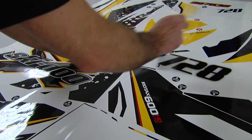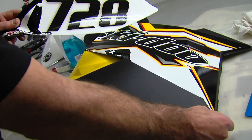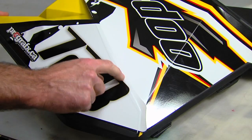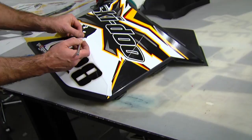The second piece we're going to use is the lower panel. This is the XRS kit, so you get your custom race number on there — you can pick whatever number you want. There's a point of reference: we want to line up this bottom edge — it goes above that line. This maybe takes a couple of tries to get it lined up. We also want to make sure that we're inside the edge here. There is some overlap here — depending on the kit, I will usually go in and trim it back a wee bit, because this is going to overlap my stripe. I'm going to trim that back after, so don't squeegee down over there.